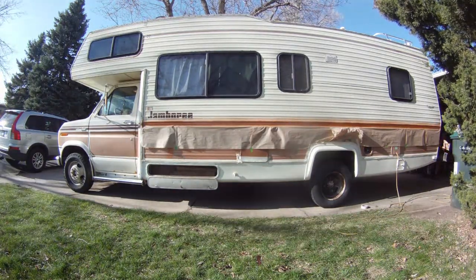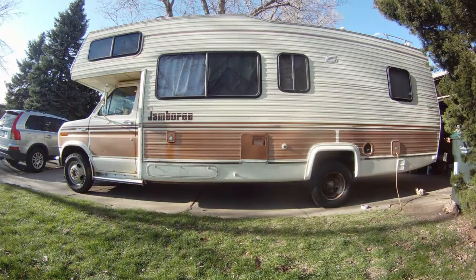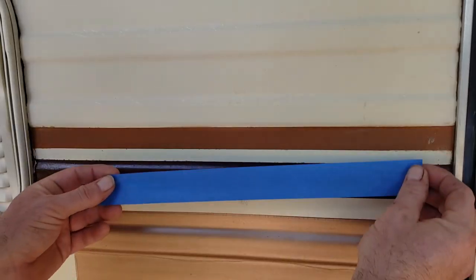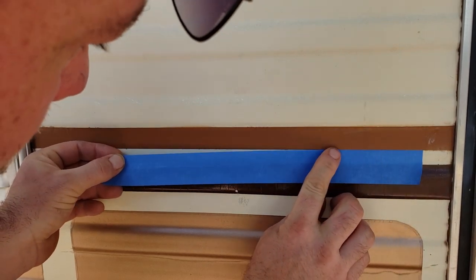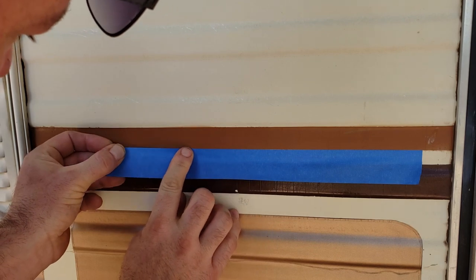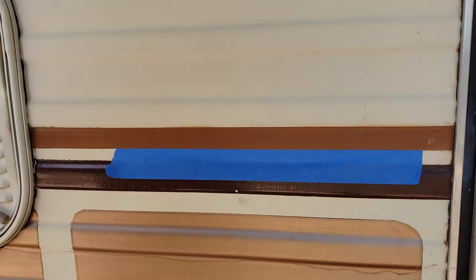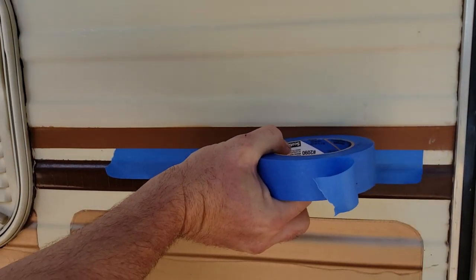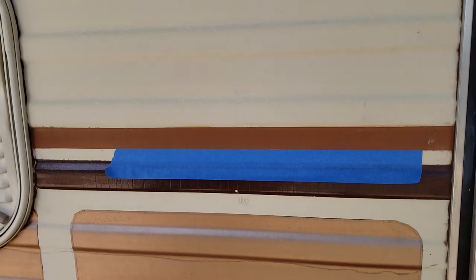I also did a little bit of beige on the bottom skirting area of the RV just to clean some of that up, and that was just one stripe for that particular day. Here's a little tip: when you're putting on the tape, if you don't want bleed-through — where the paint goes underneath the tape — put it on carefully with your finger, then take the roll of tape and just mash it against your applied tape and pull it all the way down. That gives you a nice tight bond so you don't have any bleed-through.